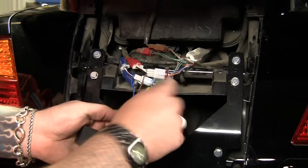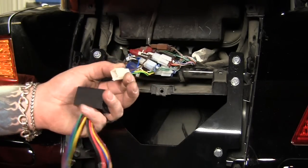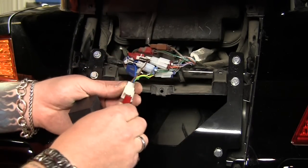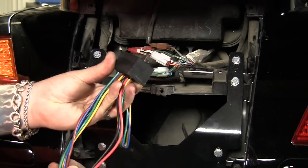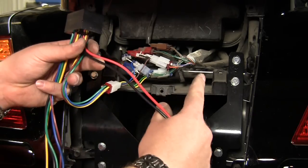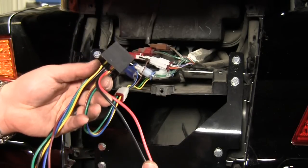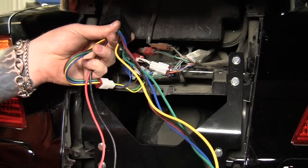I've already installed the wiring harness into the Honda's factory wiring harness, and that'll give us a four-pin plug here which our relay is gonna plug directly into. That's gonna go right to the relay. Now you've got a long red and black wire — this needs to be run up to the battery so the relay can pull its power from the battery instead of from the bike's wiring system, and that'll give you ample amount of wire that'll go to your trailer.